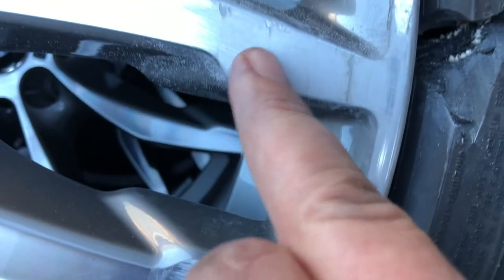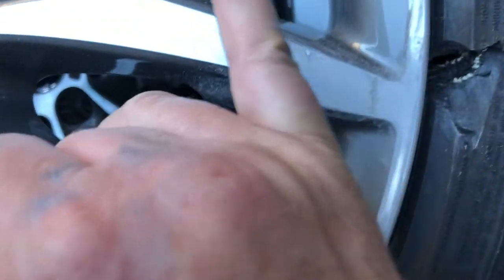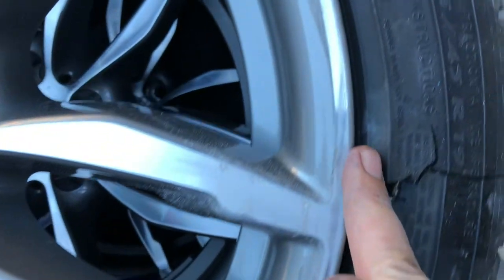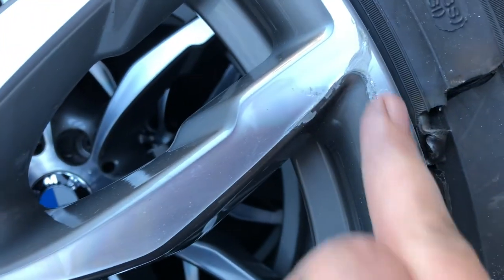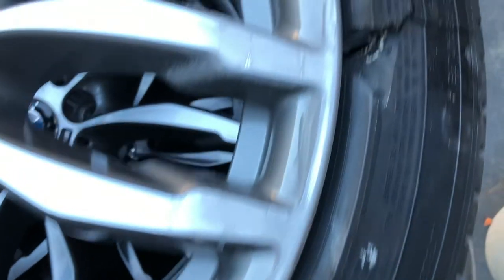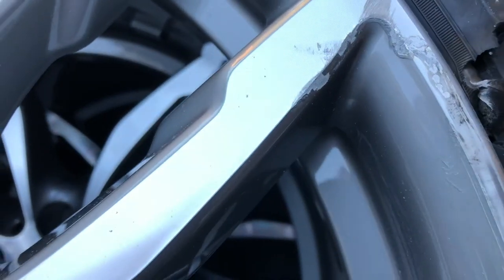This polished edge is different — I know I'm going to have to replace the clear because it's been knocked off in places. It's coming out really well. I'm going to do a patch repair; I'm not going to paint the whole wheel. I just want to repair the specific areas and keep the repair area as small as I can.